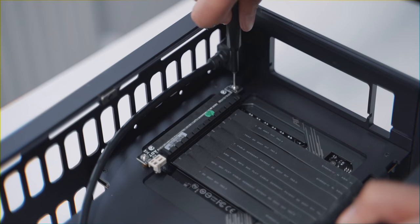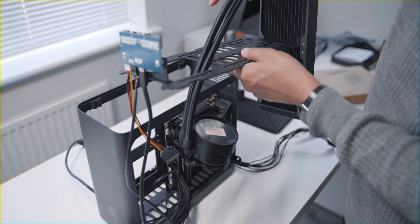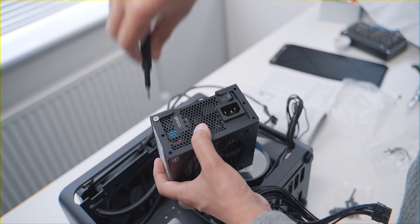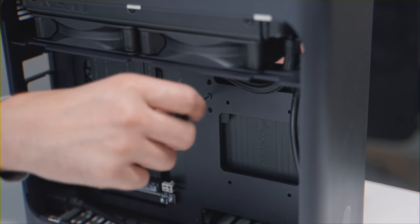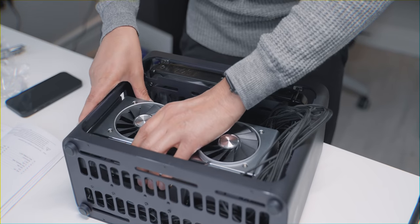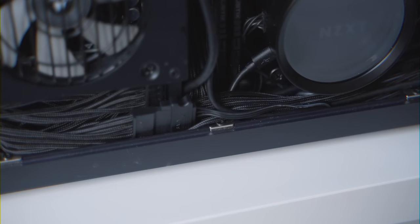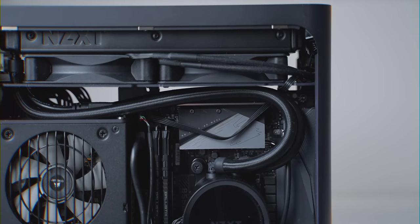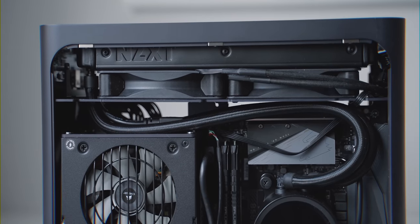When mounting the AIO cooler, remember to put the cooler itself through the top bracket before putting it back on — otherwise you'll hate yourself; trust me, I've already made that mistake. This is also a good time to attach any connectors to the top panel. Next up is attaching the PSU extension cable to the PSU, mounting it to the bracket, connecting the power cables, and mounting the PSU to the case. Then finally, install the GPU and put the case back together. Everything is super tight and there's really no cable management other than stuffing cables wherever you can, but thankfully you can hide them quite well. The AIO cooler in particular was a very tight fit — you have to hope the tubes are flexible enough, as thicker and more rigid tubes will be pretty much impossible in this case.